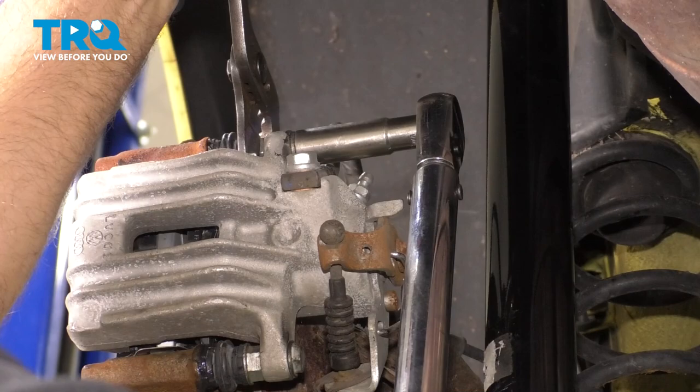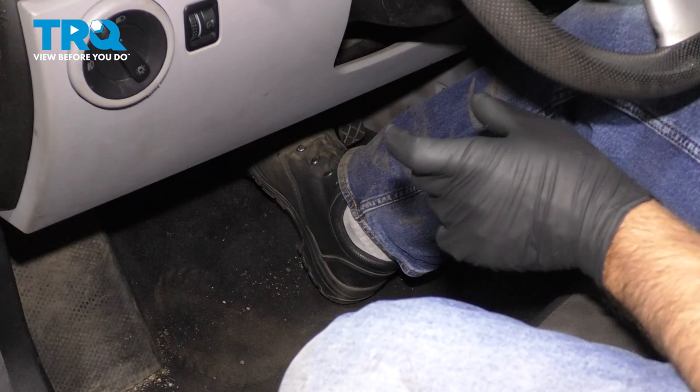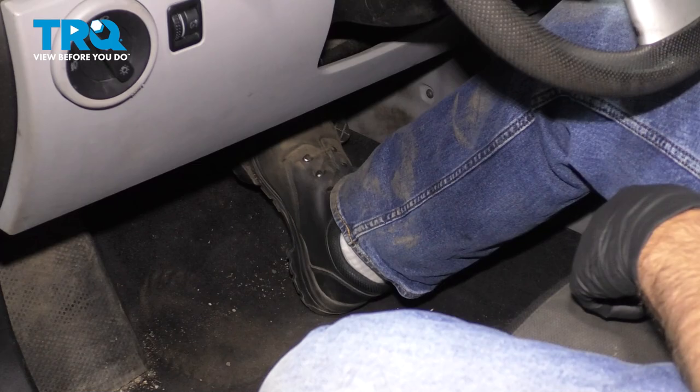After you're done, you wanna pump the brake pedal nice and slow. There's gonna be a little air gap between the brake caliper and the brake pads, so you wanna take in that air gap. Once the brake pedal feels pretty good, you'll be all set.